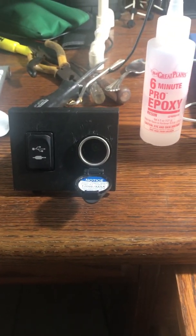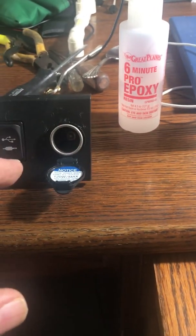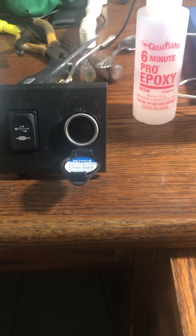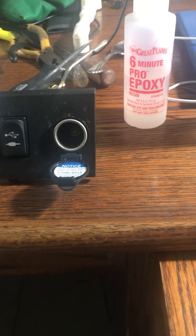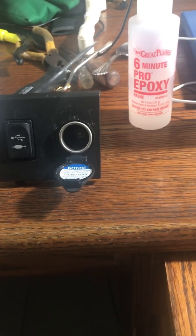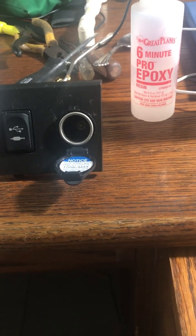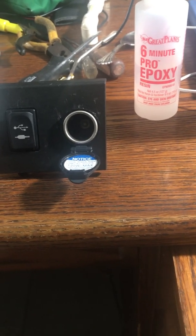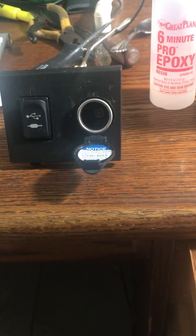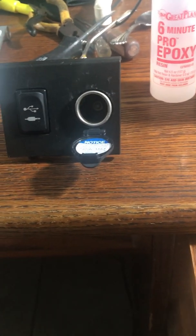And so when I checked the continuity on this thing and it was okay, I then went back to the fuse box, and lo and behold, when I looked at it really closely, I pulled the 10 amp fuse out, put it one notch over. It's really tiny, so it's pretty easy to make a mistake because you're upside down backwards and you can hardly see anything. And when I put it back in, voila, it started to work.